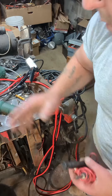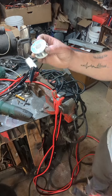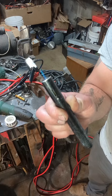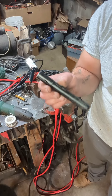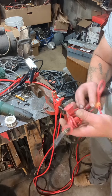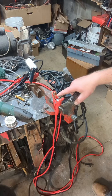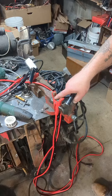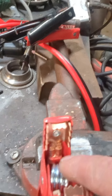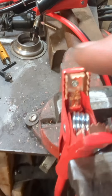What I use to fix these is some flux core solder I get off Amazon. I intentionally look for tin-lead solder with real lead in it, because nothing works better than lead in my opinion. I'm using a micro pocket butane torch that I love — I'll post a link in the description. You can also use a soldering iron, but you'll need a really powerful one for this size. What I'm going to do is take the end of the aluminum wire where it's clamped around the electroplated copper and completely cover all of it with solder — the wire strands, the clamped area, and the electroplated steel part — filling that entire contact area with solder.